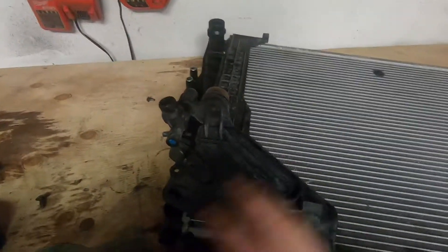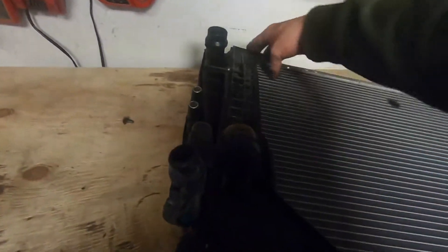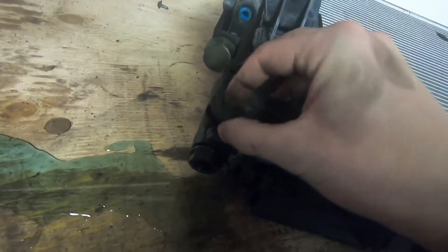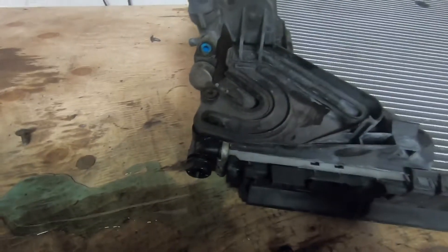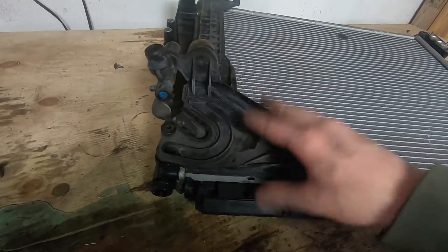I've now pulled off the automatic mounting plate. This slides in and mounts in the same position. You just make sure your little clips are in the right plastic spots, the top is clipped on, and both holes and everything are lined up. It takes a second to line it all up, but it ends up being in the same position where the drain plug goes into the same hole. That drain plug is going to seal right above that hole. And when you actually drain the coolant on your manual, with the manual mounting plate on here, the coolant will actually come out of here.